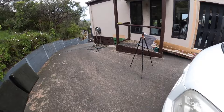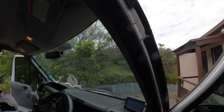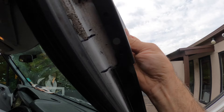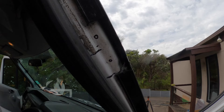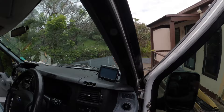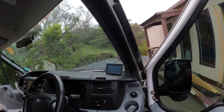So we're going to do some modifying to the brackets and attach them with rivnuts — not those self-tappers. You can see what I've done here already: I've trimmed off the plastic and you can see those two holes go absolutely nowhere, going to no man's land. That bracket needs to be extended another probably 15–20mm, then we'll re-drill the holes. We're going to go straight through the middle here with rivnuts, bolted to the frame. The three holes from the top can just go straight in. We'll take these brackets down to the shed and weld up some extra-long sections on the bottom.